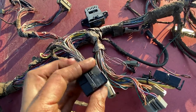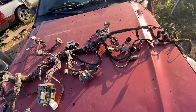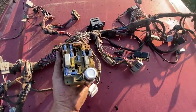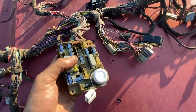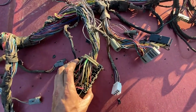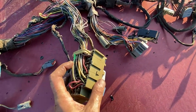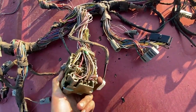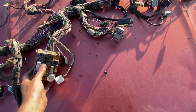I don't know if it's worth changing everything out today to delay your package, but if I have time — it's four clips, pretty easy. You ordered grade A; I'm going to try and get everything done without delaying the part getting there this weekend. Fuse box — Ken, she is in wonderful condition. It's not been hot, not been heat cracked, not been over tightened. You should be able to bolt this right back in your car. Nothing's been taken out of it — the flashers, the circuit breakers, everything's there. And the best thing about this part of the harness is that nobody ever tapped into it. There's no alarm system, no police lights, nothing.